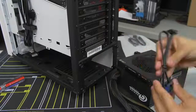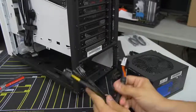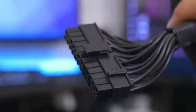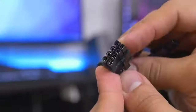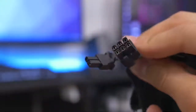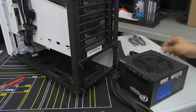I've already figured out which cables I need. The essentials that are connected are the 24-pin ATX — this goes to your motherboard — and the 8-pin EPS, which is the CPU connector. We've also got PCIe connectors for the video card — two eight-pin connectors in a six-plus-two pin design, which will be plenty for our video card. For peripheral cables, we need SATA power cables for our two drives — one SSD and one mechanical hard drive.